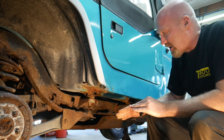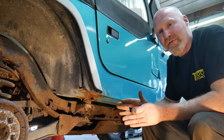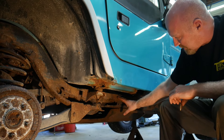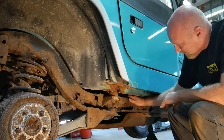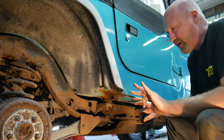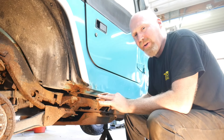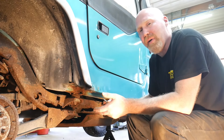To do that we're actually going to have to use three kits because we don't have one kit solely that will cover this whole thing - and that's actually a little bit to our advantage because we have several positions to maintain: the position of these bolts here and the position of our control arm mounts. That'll allow us to install some good material. We'll work here on the center, and we'll have a rear kit and a front kit to make sure the center section kit is tied in well. We'll start in the center, weld this kit up, and then build off of that center section. We'll post another video showing comparisons before and after. Now let's talk about a few other areas of the frame that you'll want to look at if you're looking at purchasing a TJ or if you've already got a TJ and you're concerned about rust.